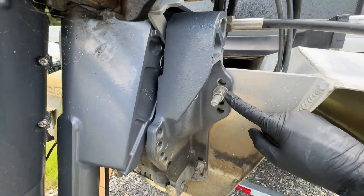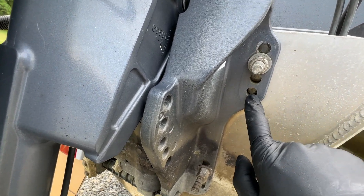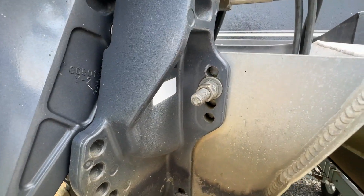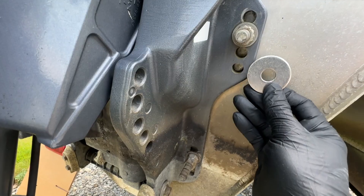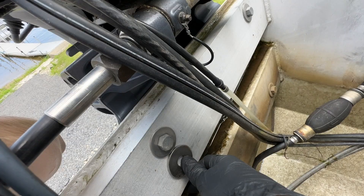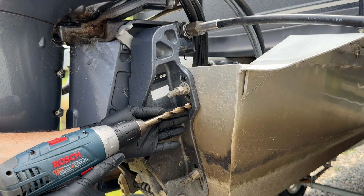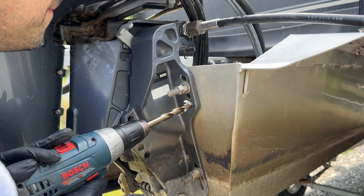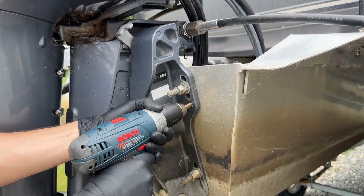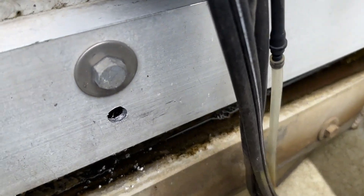You can get a look at my motor mount here. Based on where the existing mounting holes are, I'm going to drill a hole in the bottom-most mount hole so I have a minimum of 1 space between the 2 bolts that will hold the Turboswing bracket. I'm curious to see if I'll be able to fit the washer for the new bottom bolt based on how much room is left from the washer on the existing bolt. I'm going to use a ½ inch drill bit for the new hole. I'll use the motor mount as a guide so I get a perfectly aligned hole. You probably want to do your drilling before loosening the existing mounting bolt, since the mount will lift away from the transom a bit when you take it off. I want to take my time and try to line up the bit so that I get a straight hole.